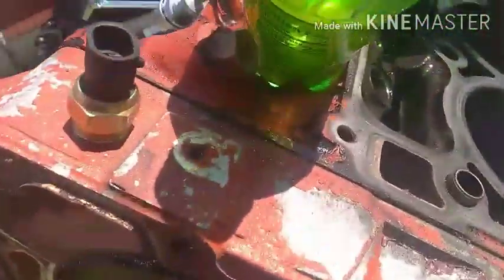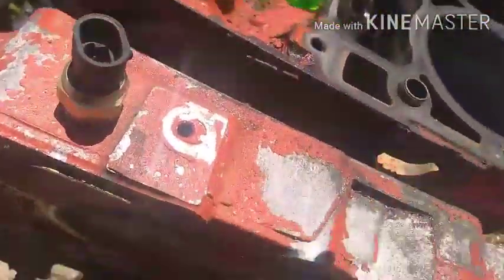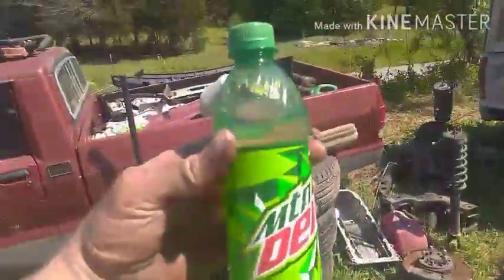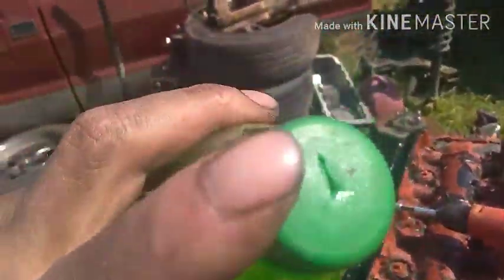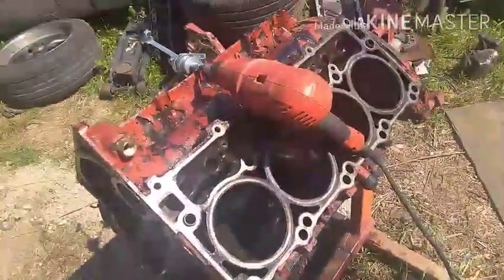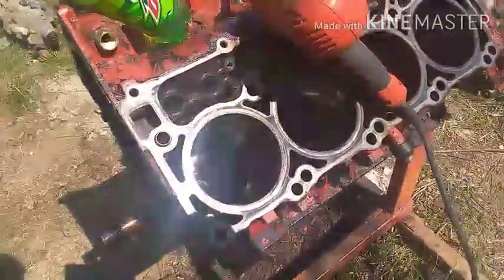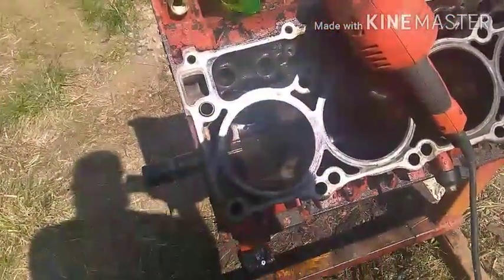Got some stones. For your budget-friendly guys - instead of buying a high-dollar bottle they don't even make anymore - Mountain Dew bottle, cut a little hole in it, fill it up with gas. You wash the cylinders down. Best fluid you can use to do this is gas - lubricates just a little but it also lets it cut good. Unfortunately I'm one man so I ain't gonna be able to show you what this is doing, but basically...